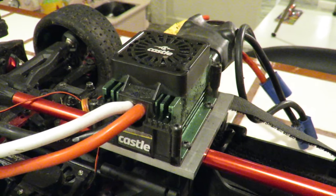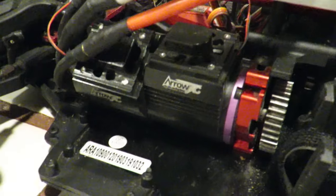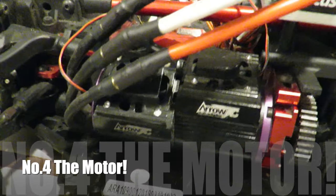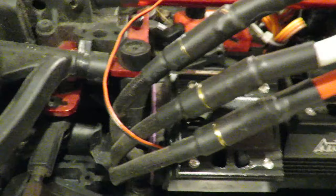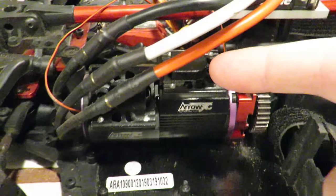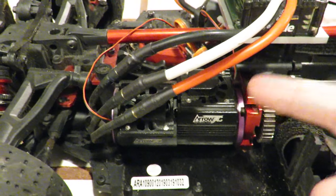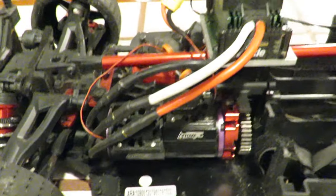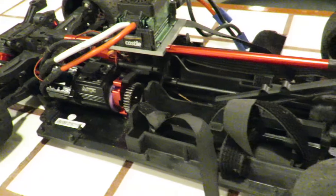When it comes to point number four: if you're able to run an ESC that can deliver 400 amps, then you might as well fit an 8S motor capable of handling that power. I've got a Poseidon 1800kV motor, which just squeezes in to the millimetre before it butts up against the front suspension. Under full throttle on 8S power, this generates 5.2 horsepower, which in a car this size is absolutely incredible.